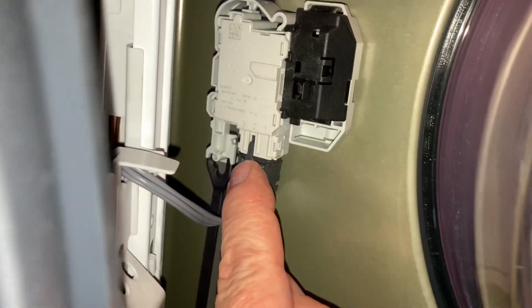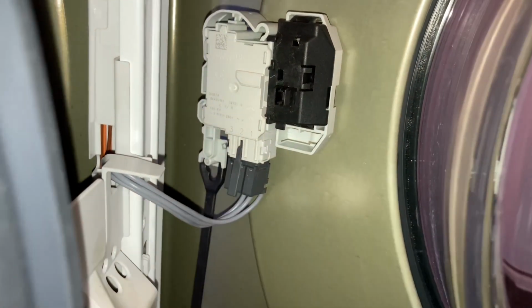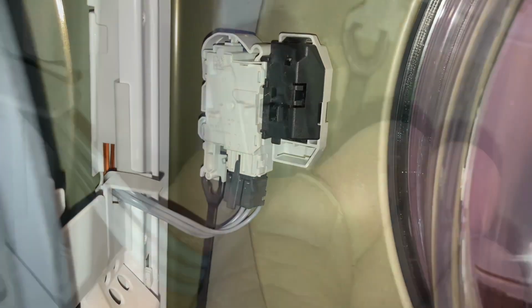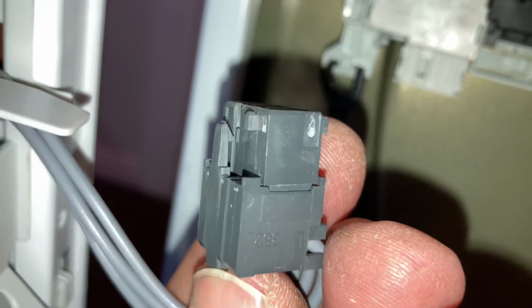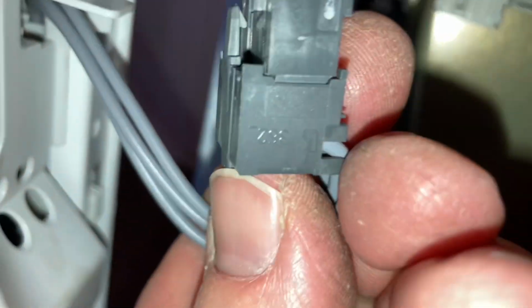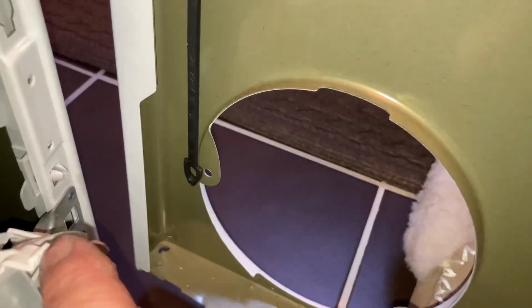I think we've got to lift that out. Somehow a little pick would be good to lift that out, I think. Let me see, I'll figure it out. As you can see, it was even easier than working on Toyotas when you think about it. So you press that there, and that opens up and that slides off. This dipstick here for changing the oil, make sure that goes back in the hole correctly when you put it back together. We'll get to that.